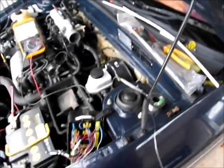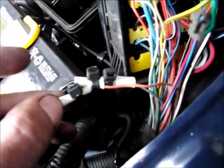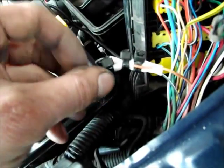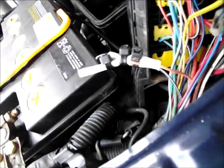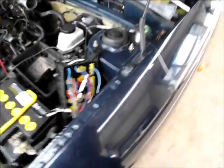Let's get this happening. I pulled the two trigger wires out of the aircon relay, and the reason I did that was simple — because I don't know what the hell it's connected to. The meter shows me ground on both these cables and I don't know what's on the other end. I just pulled them out; they weren't doing anything because there was no relay there since it's not got aircon.